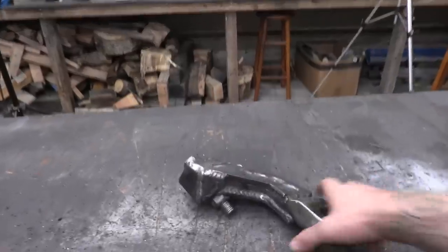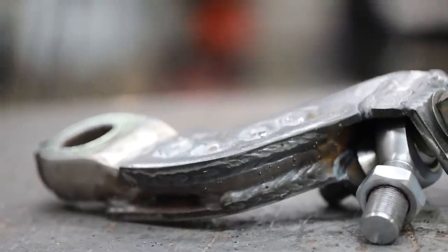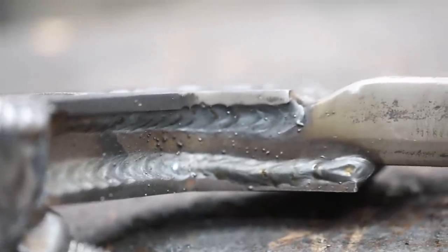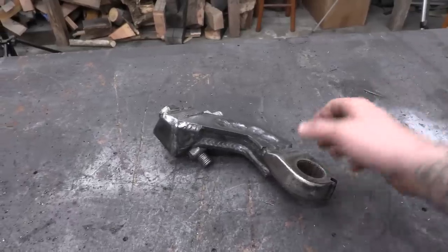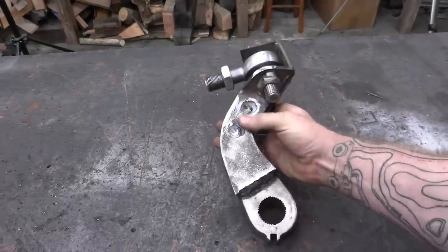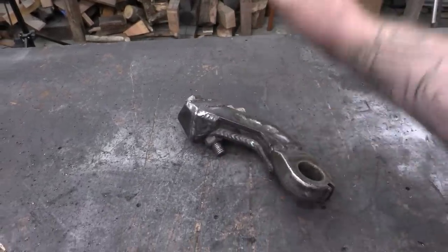It's not a pretty pitman arm, but it's my pitman arm. All the welds laid in just about perfect — no porosity anywhere. It was very easy to marry the two different materials; they're both steel after all, cast steel and mild steel. With the welder turned all the way up like that, it was turning the piece blue — plenty of penetration and plenty of heat. Now I want to bolt this in place and do a test fit to see exactly how much clearance we gained.